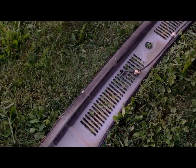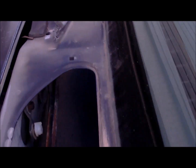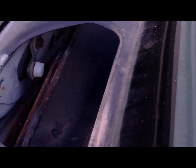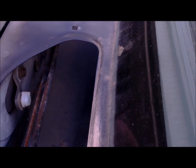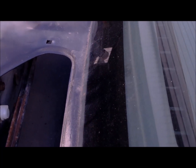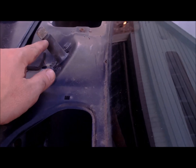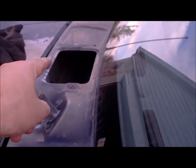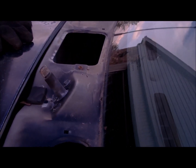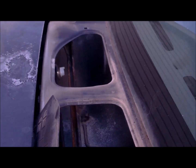I had to take off this big piece that goes up in front of your truck. Inside here is a little arm that goes to the motor — you can't get to it any other way to attach this piece, so you've got to tear all this stuff out. Take the wiper blades off and pull this out. There are going to be lines attached for the windshield washer fluid. These are a bear to get out because the clip doesn't want to come out. There are screws on the inside of this track to take out, one at the very top on the outside, and then you need to pry a little bit with a screwdriver.